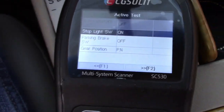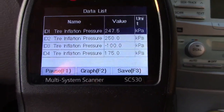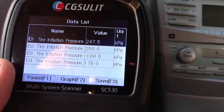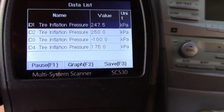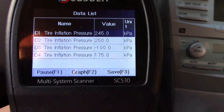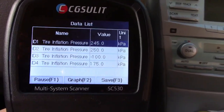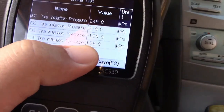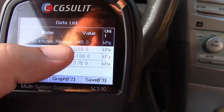So it can read and knows what the various sensors, switches, and stuff in the car are doing. Here's the TPMS. You'll notice a strange value in D3, and that's because that sensor is not working — it shows a negative value, which is of course impossible. I know that the sensor in that wheel is bad, and it is absolutely correctly reporting it. The unit is KPA, which can be changed in the menu. One of the tires is also low, so I do have to check the pressure.